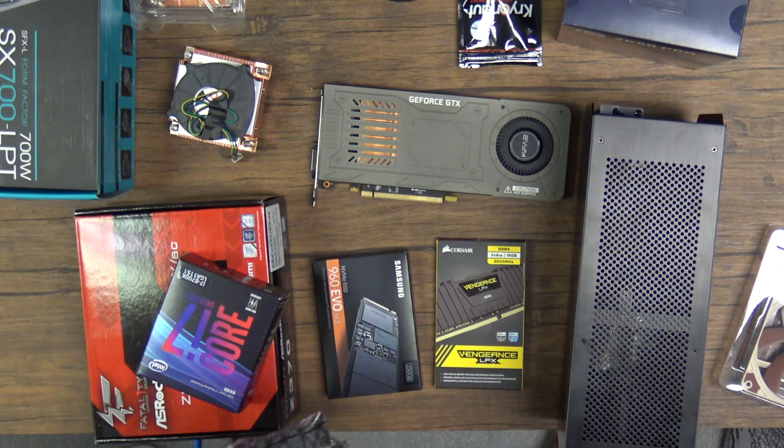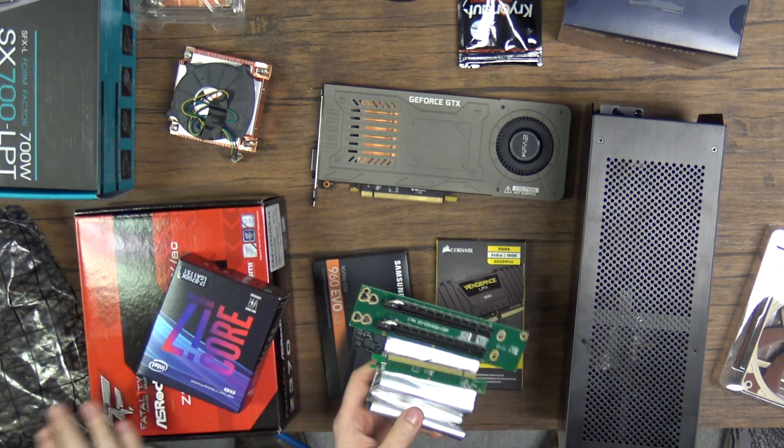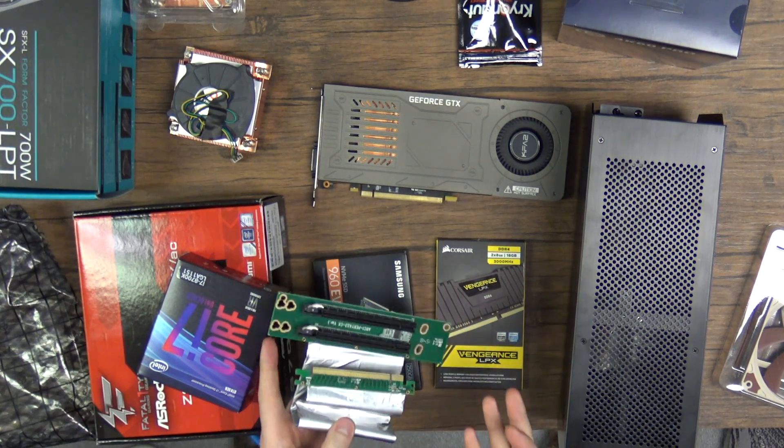In order to get both the graphics card and the 4K60 Pro onto a mini ITX board, you need to do something called bifurcation. This is probably the most complex part of this build. I would encourage anybody who just needs 1080p 60 and doesn't need to record 4K on the go to just use an Elgato HD60S and put any old graphics card in the pre-installed riser that's in this case — that will work just fine. I just wanted to go completely over the top with these guys because we don't hang out much, and if we're going to build a PC, why not go over the top?